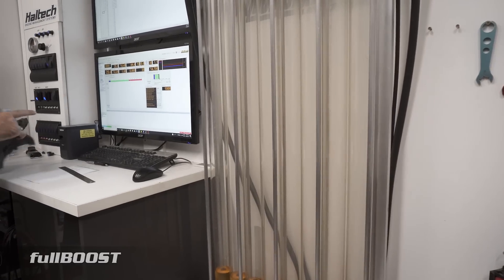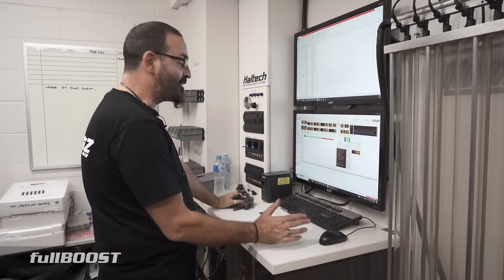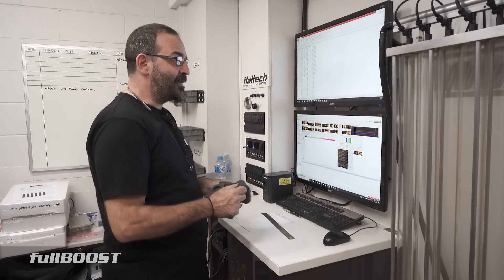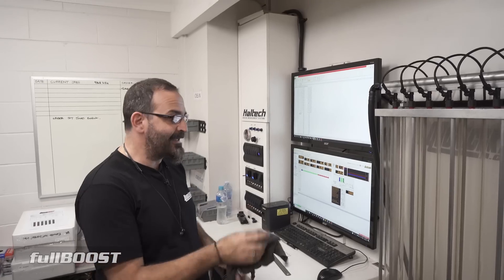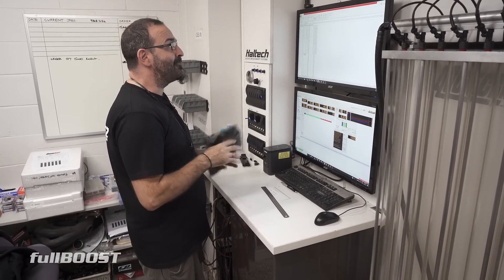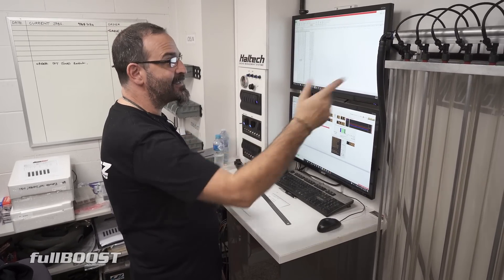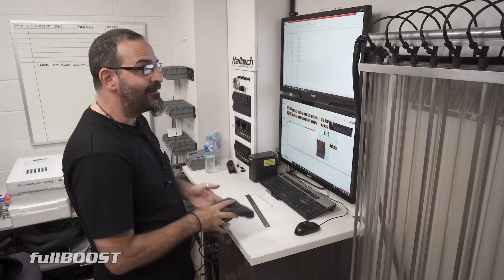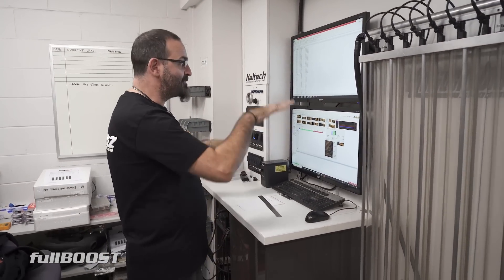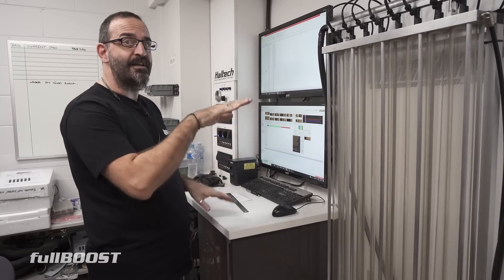As I stated earlier, we try and maintain a particular temperature to within two degrees. If we were to run these injectors first thing in the morning on a cold day, I'd get completely different readings. So we try and maintain a particular temperature to stabilize it. Because the injectors are firing they're warming up the media, and the pump running also warms it up. This particular system is on a closed loop, so the temperature is controlled and it switches on and off as required.